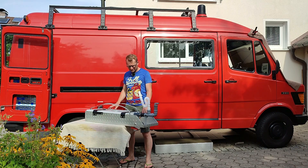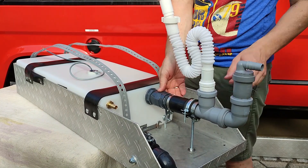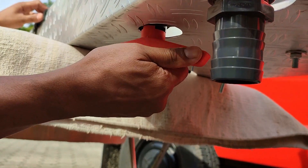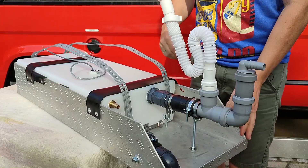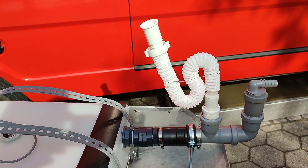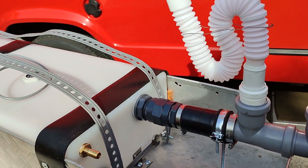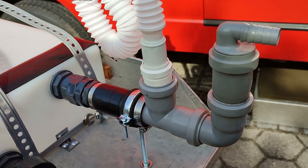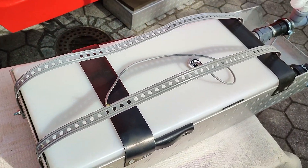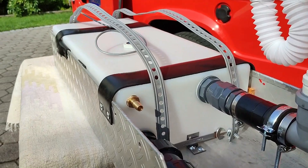Here's the final setup for the tank: the aluminum box with the 30-liter tank, the tension straps to hang it, the fill level sensor, the inlet from the sink and from the toilet with the non-return valve, and the faucet to empty the tank. The ventilation slash emergency overflow is also in place. The sink pipe gets a connector for 32 mm and then a flexible pipe that we can form into a U or S shape as a simple siphon or odor trap. The toilet pipe gets a hose connector and continues with a three-quarter-inch (19 mm) hose inside the van to the toilet. The two bands of black rubber protect the contact area between the tank and the steel chassis beam against mutual chafing.